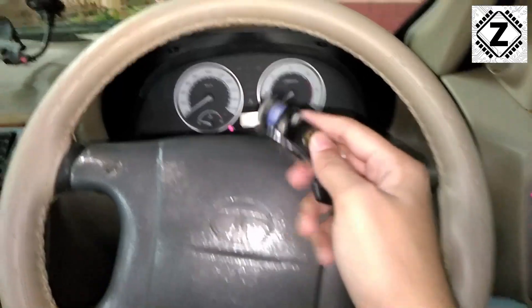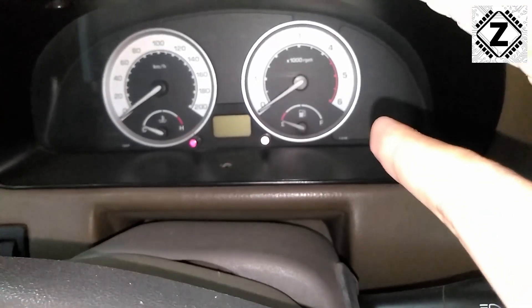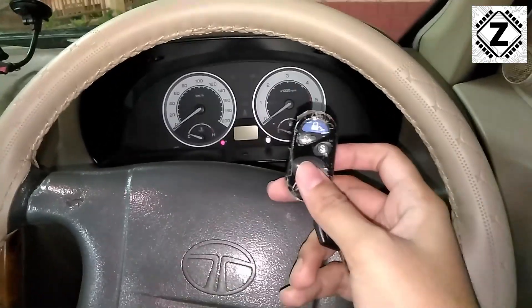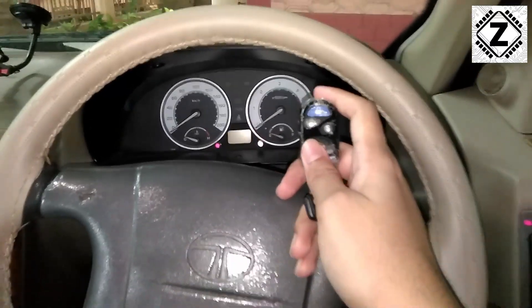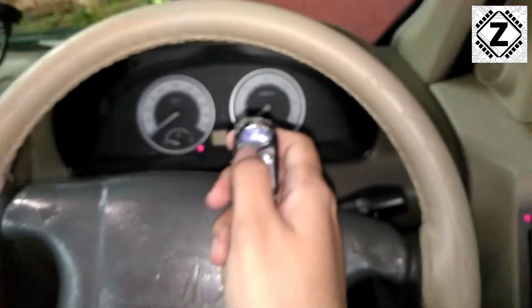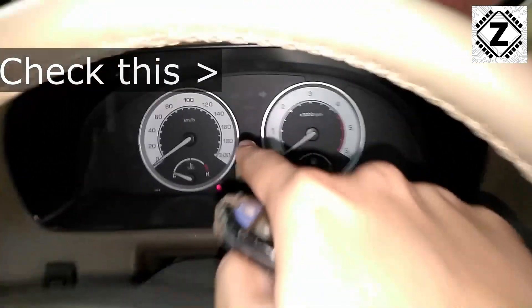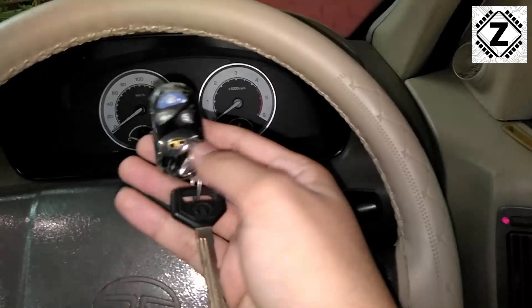When communication breaks, the car enters lockdown mode. You can see the immobilizer light flashing and the instrument cluster and other features of the car will not work. To unlock the immobilizer, the process is very simple. Press the unlock button — the one with the open padlock — like so. The indicators of the car will flash and sometimes the locks will reset.